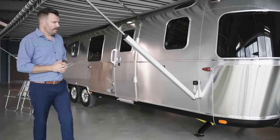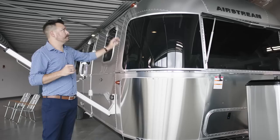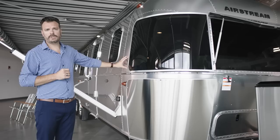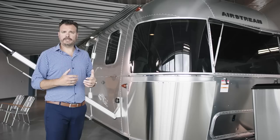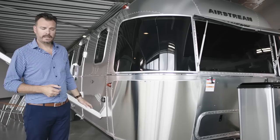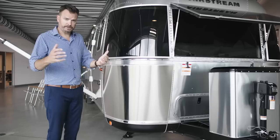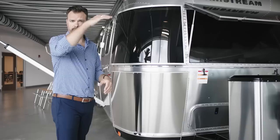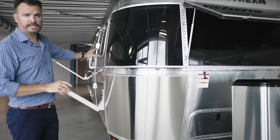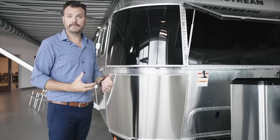First and foremost, like all Airstreams, we use a semi-monocoque aluminum superstructure. The entire exterior skin, as well as the roof and bottom plate, is all aluminum. The interior walls utilize aluminum I or Z-beams — they have an aluminum shell within the shell. The reason we call it a semi-monocoque superstructure is it mates with a separate chassis, and when those two pieces are put together, it identifies the overall strength of the unit. With most travel trailers, the chassis is the main strength, walls go up, then the ceiling. With Airstream, the shell is made completely separate, the furniture is put through the door on final assembly and hangs from that shell, making the shell itself an important structural member.